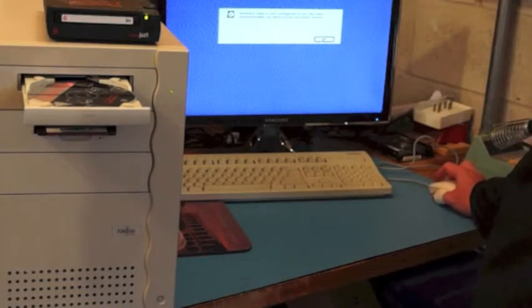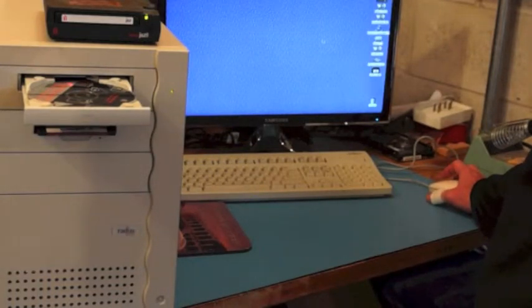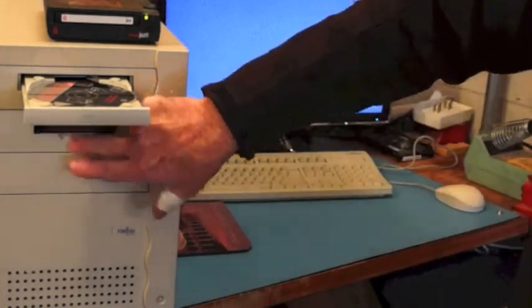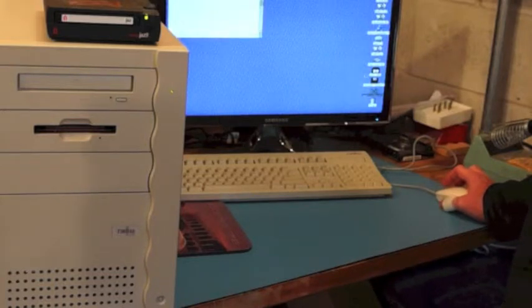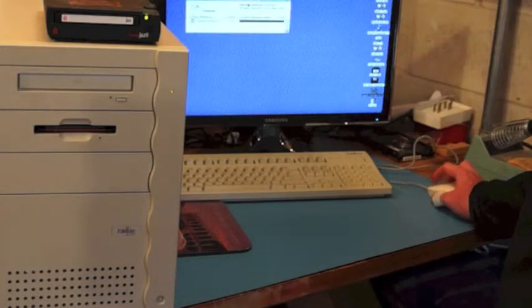And I've got an application in there called Network Time, which I got off the internet, and it needs to have a link to a server, which I didn't put in. That's what that error was about. So here we've got the Jazz mounted. We'll mount the floppy drive just to make sure that that's okay, and the CD-ROM. Floppy drive comes up, and CD-ROM comes up. We'll take a look at About This Macintosh, System 7.55.